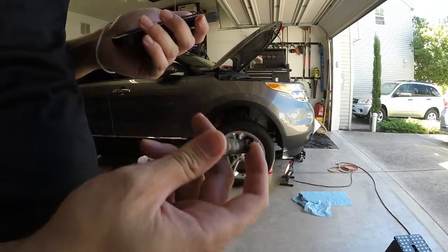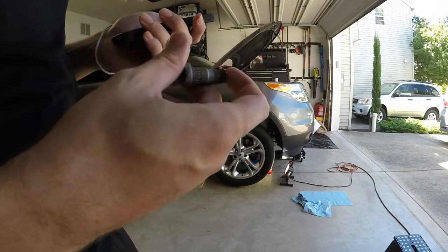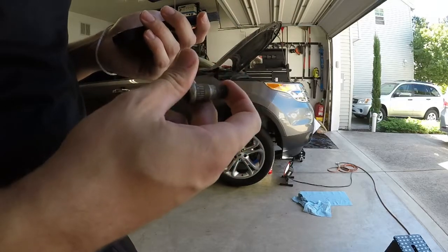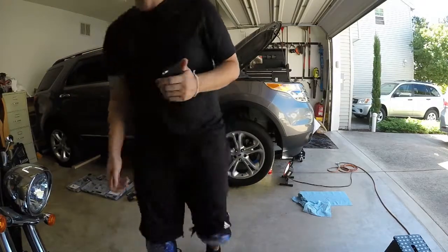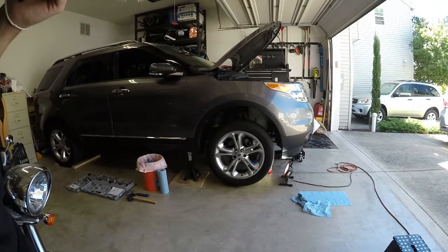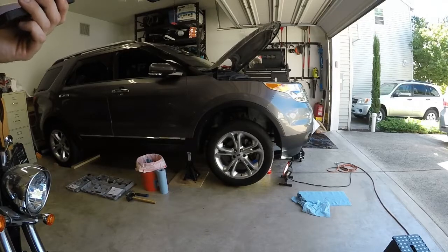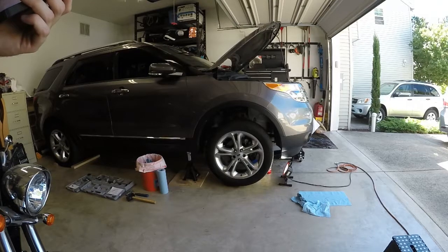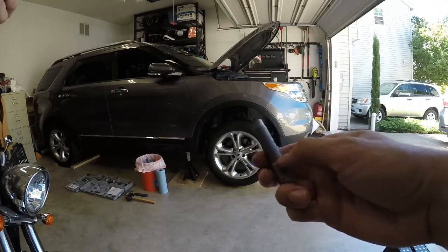Anytime you're doing brake pads, rotors, or anything where you take the wheel off, inspect it, because this could have been extremely dangerous. I did talk to a few friends, some who work at parts stores and some who worked at car dealerships. Since I do all my own work except for oil changes, because I find it's easier and not too expensive, they do more of a holistic view to see if there's anything else I'm missing. My guess is they put my tires back on and did not torque them to spec, maybe 80 foot-pounds instead of 100, and then it vibrated, and I've heard that probably caused that kind of uneven wear within the stud on the wheel hub.